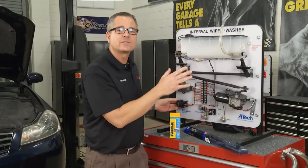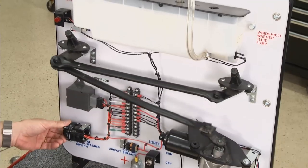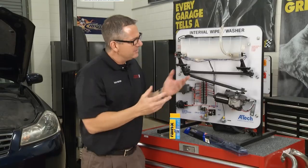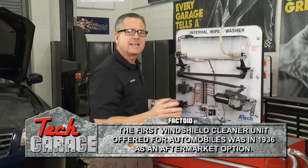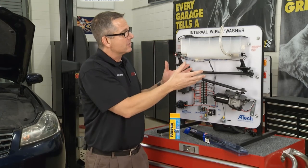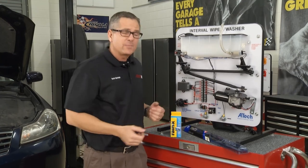There's also the washer reservoir right up here. When you push that button and pump the fluid, it washes your windshield. There's an electric motor right here. A good tip: you can go under there and feel that electric motor — have somebody inside the car push it. If you feel it running, you've got two parts of that system: the vacuum hoses and water lines that run up, and the motor — so you'll have to determine between the two. You also have Rain-X, which fills in any imperfections in the window. And the wiper blades — just follow the instructions when putting them on.